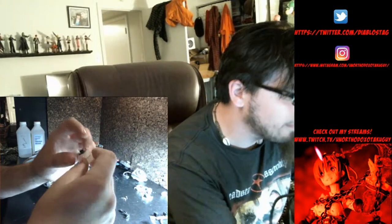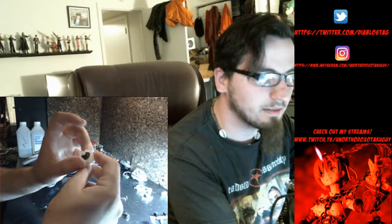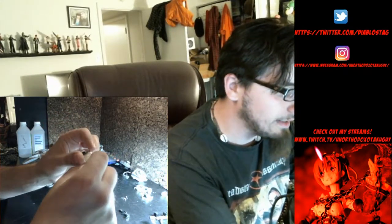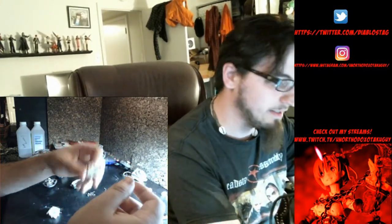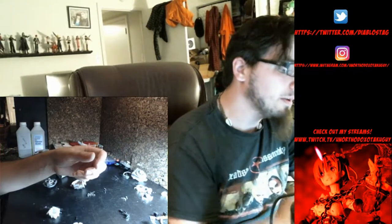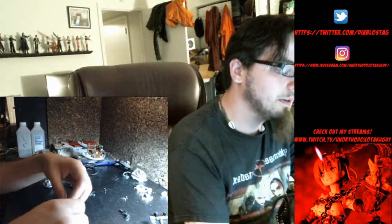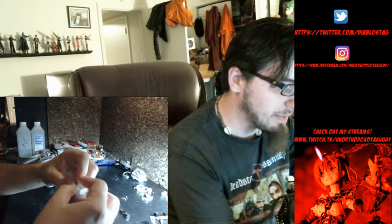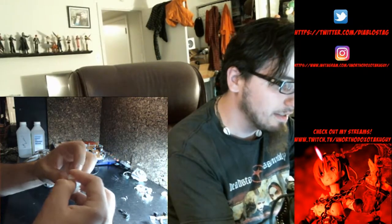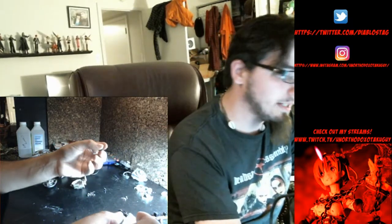And just like that, it fits in and it rotates. Now it slightly has some resistance, but it's going to be really nice when it's all together because it's going to be nice and smooth. But you do have to take these steps to scuff up as much as possible, because otherwise the overcasting can make everything bind, and the stick will actually bind and get stuck in place, which kind of sucks.